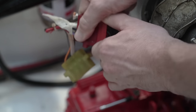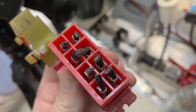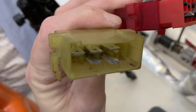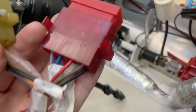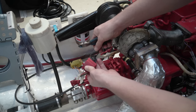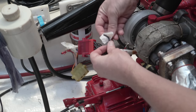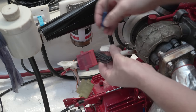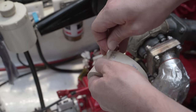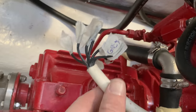I spent so long trying to prise apart the two halves of the red 8-way connector — yes I did check for little catches, and yes I ended up with dents in my skin — that in the end I gave up and resorted to snipping them on the loom side. I could only assume that corrosion had fused them together, albeit while still maintaining adequate connections. Not much current flows through wires like this. The white cable, though, had parted company from its terminal, vindicating my investigation. So began the task of noting which wires have a beginning and a middle, but as it turns out, no end — i.e., they are there to connect to gauges I don't possess. And most importantly, taping all the black wires I cut from the loom's end one by one, and writing which coloured wires they corresponded to. Otherwise the game of me trying to work out which is which would have had you all cackling. I have succeeded, and now I can retrieve all the cables through their current routing and into fresh air.